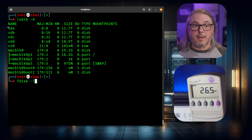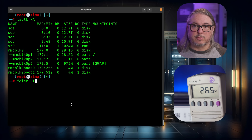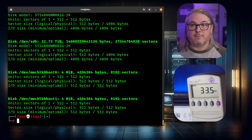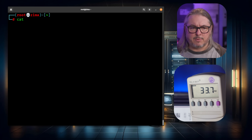Now I'm logged into the Zima and we can see the four hard drives right here. Right now it's running at about 26.5–26.6 Watts because the drives haven't been doing anything — no writes, no reads. We're going to change that by running fdisk -l. Now the drives aren't spun down; this is just the idle mode with completely default parameters. After we do the fdisk -l, we get about 34.5 Watts, so they've bumped up a little bit because there's been some access and activity on them. If we wait, they'll go back down to that 26.5–26.6.